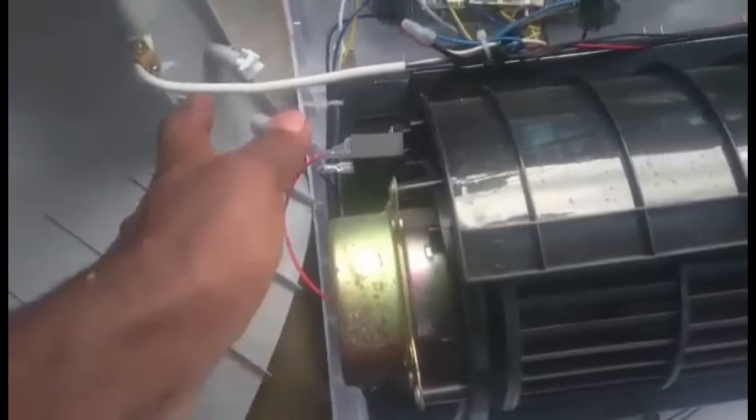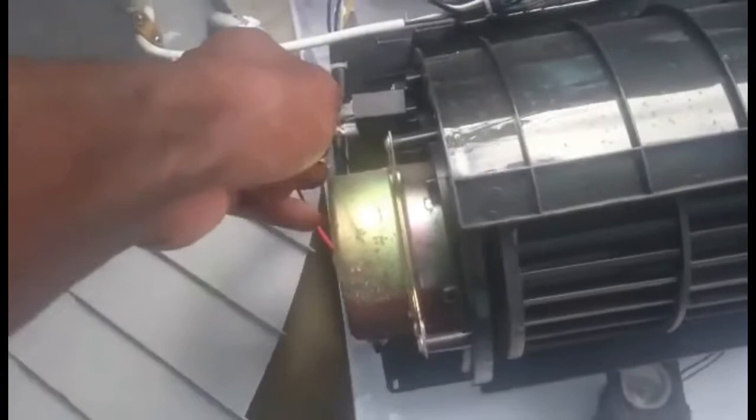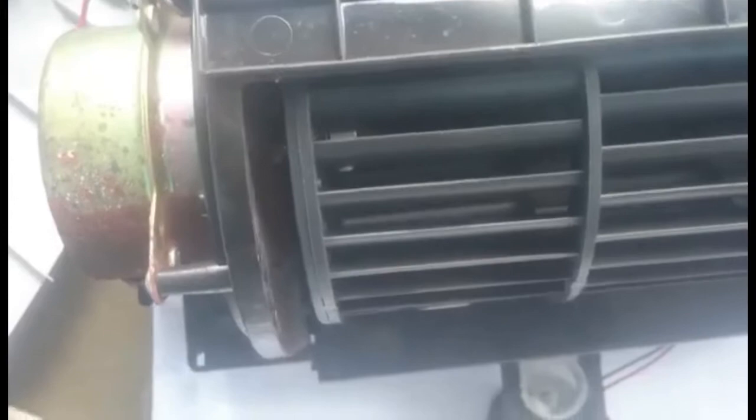These motors are made in such a way that you need a capacitor to power it up — it can't move on its own. If it's slow, there are two things: the capacitor, or a fault in the motor. In our case the fan isn't working. Let's connect it and see — it's on, watch it. See, it's moving slowly.